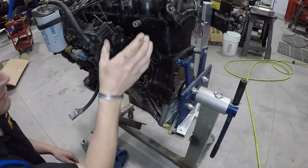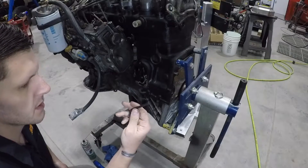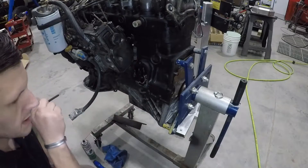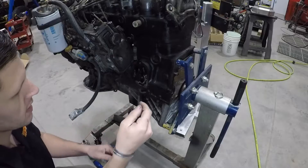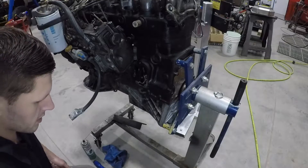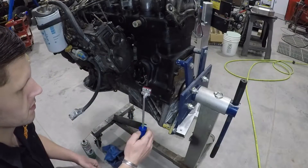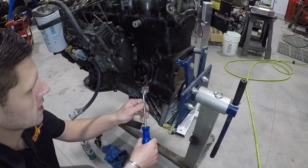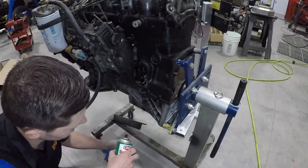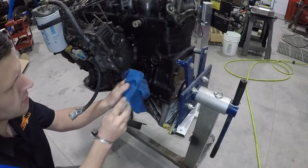As you can see here, I've already removed the oil filter housing. It uses an M6 Allen head wrench — there are five bolts. Once you get those all off, pull it straight out and you'll have this spot of the block to work with. I like to use a little razor blade on a tool to lift off the old gasket, then take some cleaner and get that all cleaned really well.